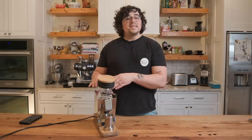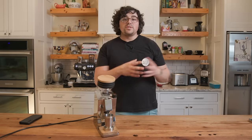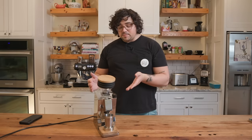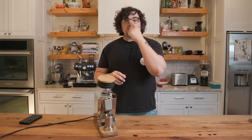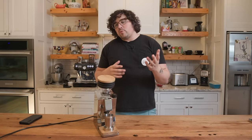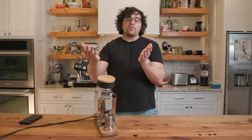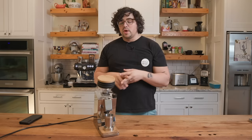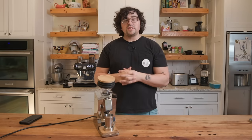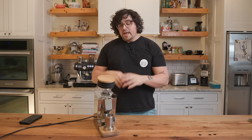The Fellow Ode has a 140-watt motor; the Baratza Forte has a 130-watt motor. This thing has a very robust motor — all of Eureka's machines do. It is an AC motor; I tend to prefer brushless DC motors, but the high power here compensates. It spins at an RPM of 1620, which is in between a Vario at about 1350 and the Forte at around 1900. The Mahlkönig X54 rotates at 1050 RPM for comparison.